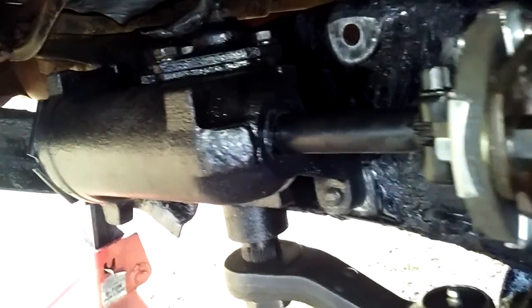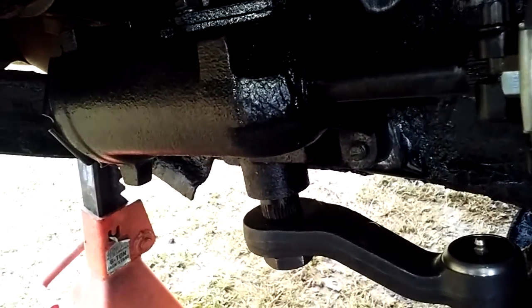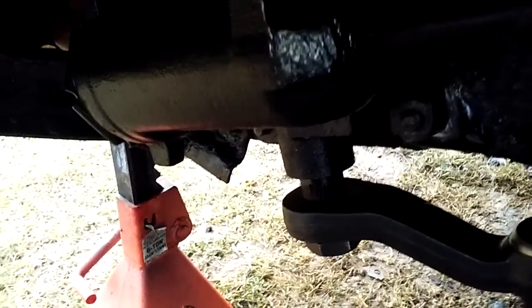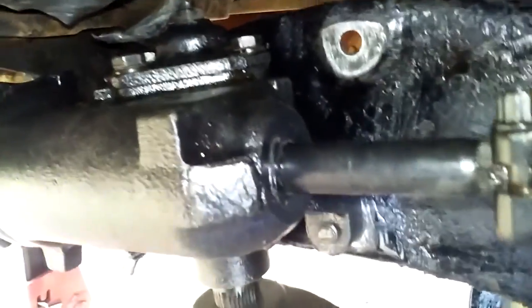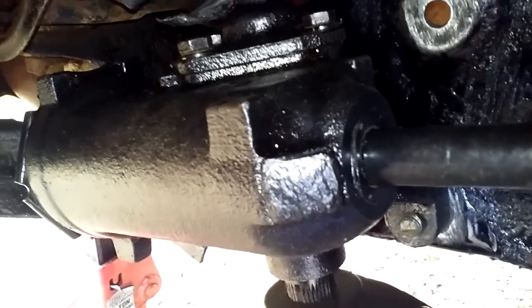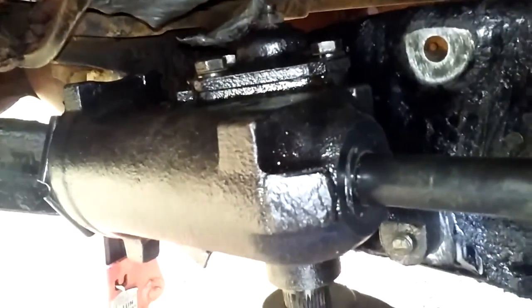Now what you need to do to convert it, first thing I would do is get on eBay and find you a steering box just like this one. Just find the cheapest one you can get, because to be honest, it really ain't a whole lot that can go wrong with them. They do wear out. Seals can leak. There's one here and there's one under here. And they can get a little bit of play, but find a good one on there that's still pretty tight. I got 55 bucks for that, so buy that.